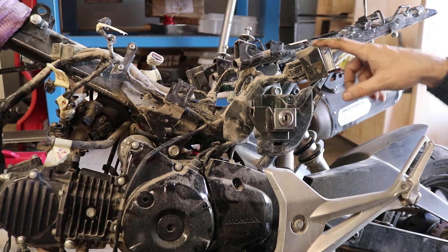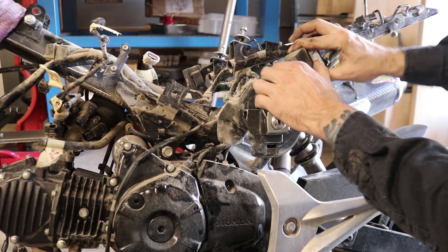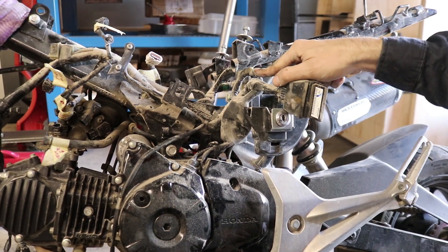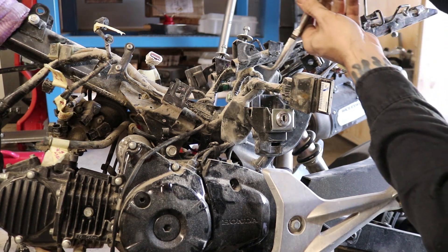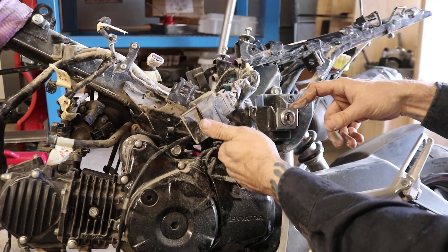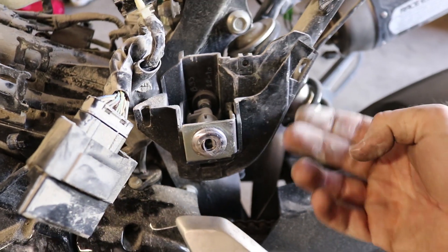Continuing to remove the wiring harness - we've got our ECM right here. This thing is held on by a little rubber holder - wiggle that off the bike, that's free. We've got a little connector right there, pull that off. There's also a box here from our little seat release - there's a bolt back in there, take that off and this thing should come off.